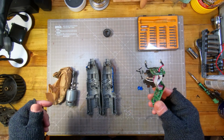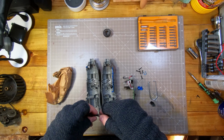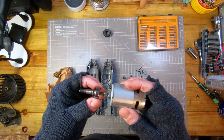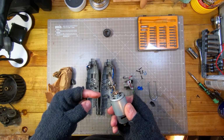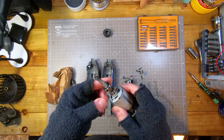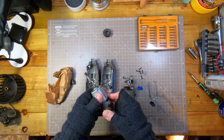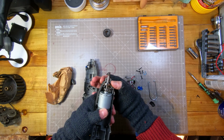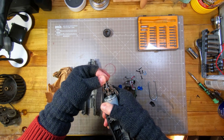However, from what I can see, the problem is the motor. So this is the motor that sits in there like that. It's got a fairly sizable bearing on the shaft. This is the locking pin that goes in to hold the shaft still when you need it to. So it's got a fairly large sealed bearing on the output shaft, but that sits in this case like that, so there could be a fair amount of movement. If you're pushing sideways, there could be quite a lot of pressure on that bearing.